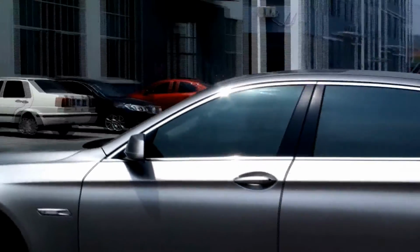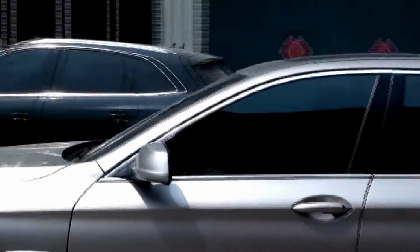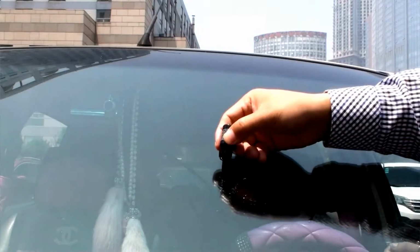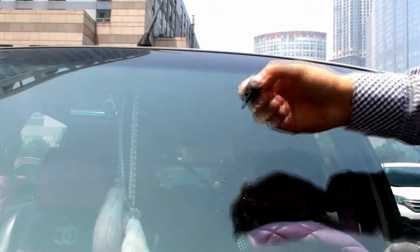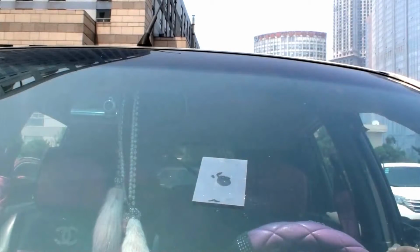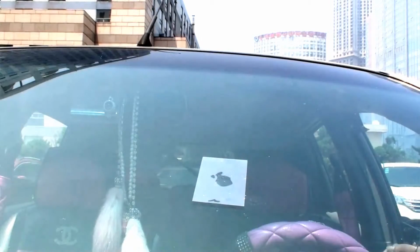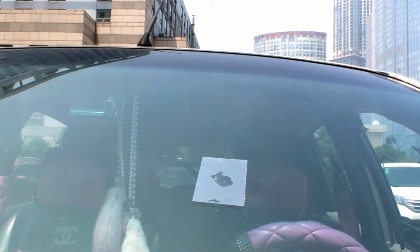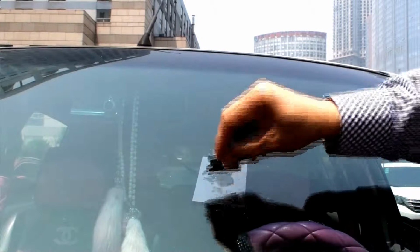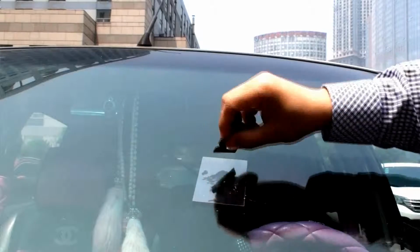Step 8. Move the car into direct sunlight. Put several drops of the resin into the center of the break. Quickly place a section of the clear finishing film over the still moist repair area. Use a razor blade to carefully press the resin toward the edges of the film so that the resin evenly coats the area and moves out any air bubbles.